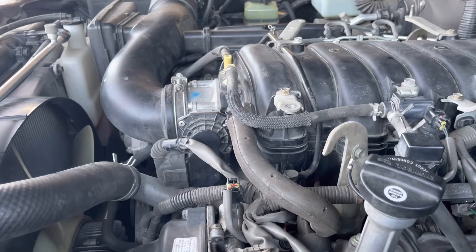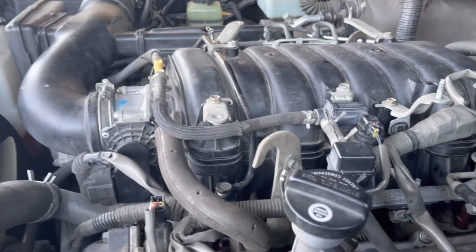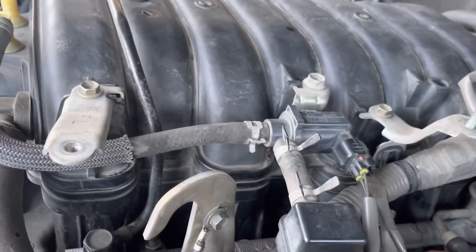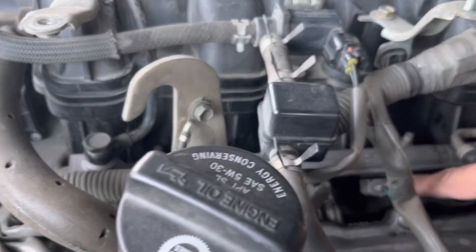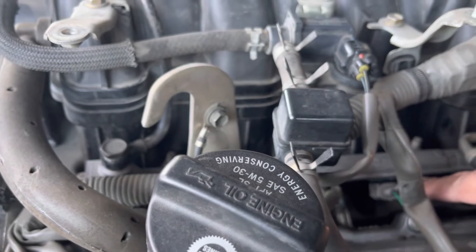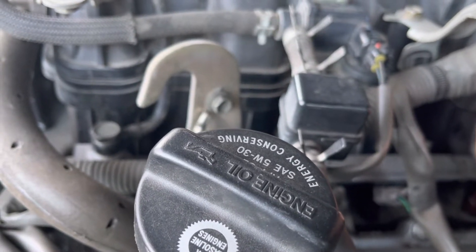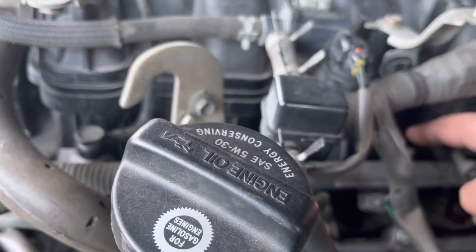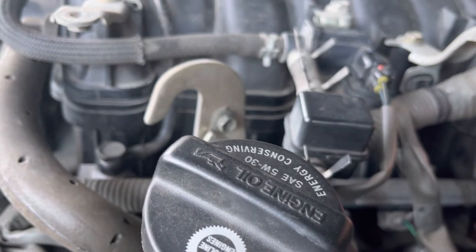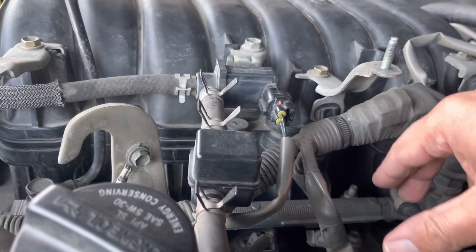There are a few tips that will help you. Whenever you are putting the fuel rail with the injectors in, sit it and make it sit in these studs, then try to rotate one of the fuel injectors by finger. If it rotates, it means it's installed properly. If it doesn't rotate and is stuck, it means you've done something wrong — that's what the factory service manual says. Without installing the nuts, when you let it sit in the combustion chamber, if you cannot rotate it, there is something wrong.